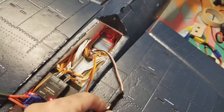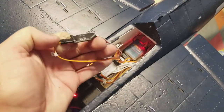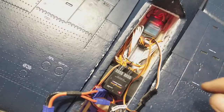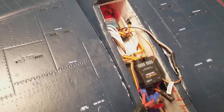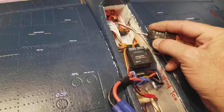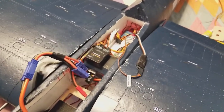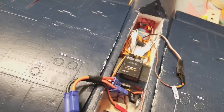I'm leaving this out loose - this is actually the FMS sequencer. I'm not using the retract door side, which is 5C. This connection to the retracts is basically for the nose wheel. I could probably get rid of this sequencer and plug it into the retracts down there, but they're incompatible. This FMS sequencer only really works well with the FMS system it was designed with. These are actually original stock FMS sequencers, except the output is made special for this Tiger Cat - it's reversed compared to all other FMS sequencers, and it has a longer delay to allow for this special gear on this airplane.